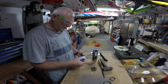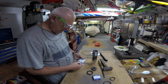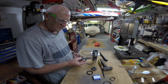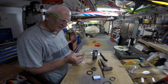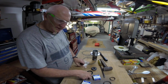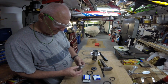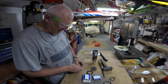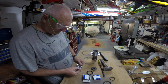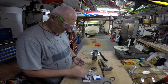Okay, I've got the new bearing set here, the new seal. That's the brake caliper lock tab. I don't need that at the moment. What I'm going to do is put the larger outer race in, an NSK. I'll drift it in with a hammer and a bit of brute force, but that's the new bearing, new outer race and a race.